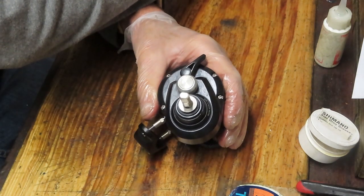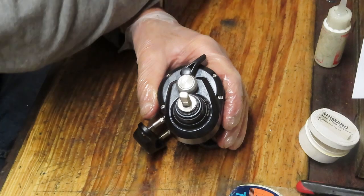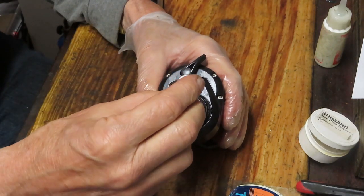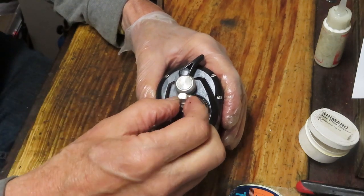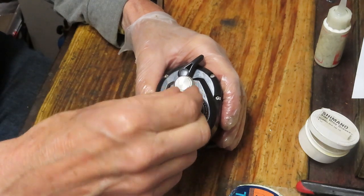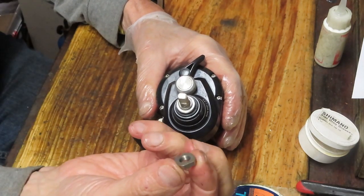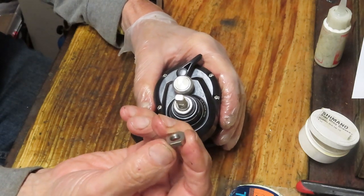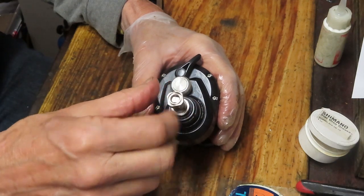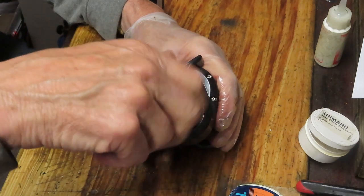Again, you can go back and check your orientation of these through your photos. We had the 2 that are curved, and we have the smaller one that fits, and then we have the flat washer that's underneath the nut that the star adjuster is going to use for the tensioner. Remember, 1 flat side, 1 ridge side. The one with that indentation or ridge is the one that's going to face up to accept the spring.